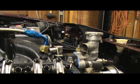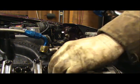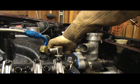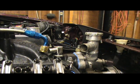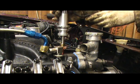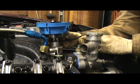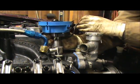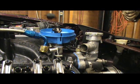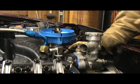So what we have to do, now we got our harmonic balancer on 30. Both our intake and exhaust valves are closed. So now I'm gonna take this plug that I had in the distributor, and we're gonna slide this in. I know where I want my wire. I want my wire on the front of the motor. I want it square to the front of the motor.